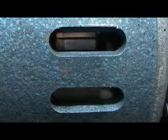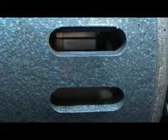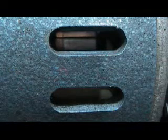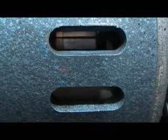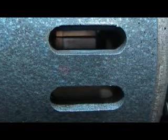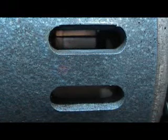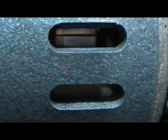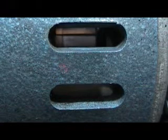Okay, right now we're looking through a vent window in the side of this motor to see the commutator. The commutator is the actual copper piece that the brushes rub on to transfer electricity to the motor. If you have high amperage going through the motor, caused by a worn belt and deck, long extension cords, the brushes can actually spark on the commutator. That continuous spark will leave a layer of carbon, which makes it harder for the electricity to cross that point, thus creating another point for amperage to increase.